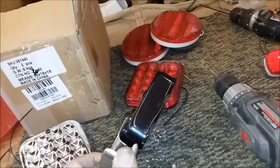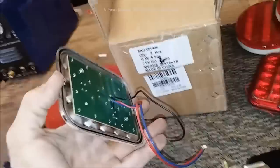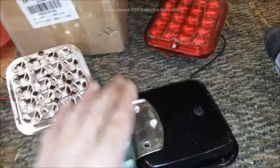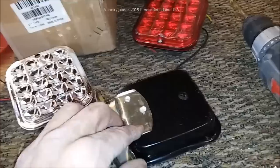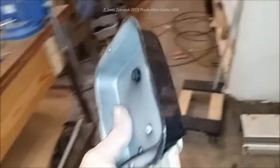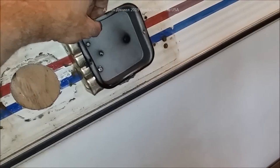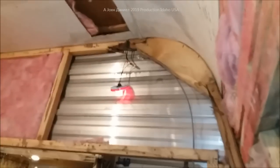These are made for a trailer and are meant to be mounted a certain way, but we're not going to do that. So I'm drilling out the rivets — you want to remove your light fixture assembly for all your LEDs using a quarter-inch bit. I'll add two more holes here and then we'll just have the flat plate. I'll caulk-seal that because I don't fully trust them for waterproofing, and then we're going to mount them. Right now we just have all the wiring hacked together and a battery for testing.